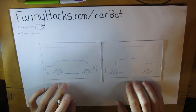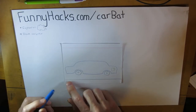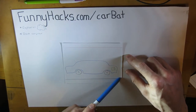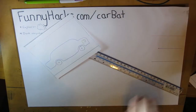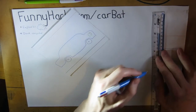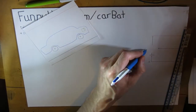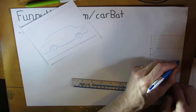So let's start with what is voltage. Voltage is the potential difference in charge between one area and another area. If you're looking at a power source — we apply a power source here — that would be plus 12 volts and that would be zero volts. Here is our negative line. On a simple circuit it would look like this. If we say this is zero and this is 12, at this point this one here is a 12-volt line and this is a zero-volt line.